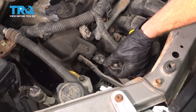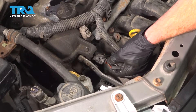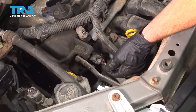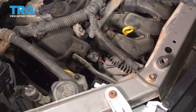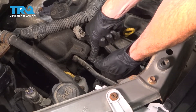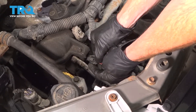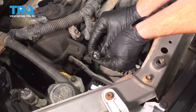Let's move along to the electrical harness. Right where my thumb is, along the top, there's a squeeze tab. Squeeze that down, pull this off, and inspect it for corrosion. That looks fine, I'll set it aside.